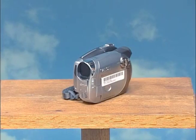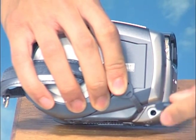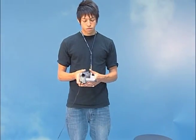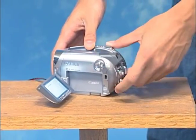Now that we've recorded all of our segments, we're going to want to finalize the disc. In order to finalize, the DVD camcorder needs to be plugged into the AC adapter — probably just a safety function to ensure a constant power source. Plug the AC adapter into a secure outlet, then on the side there's a small black input hole. Insert the small end into the DVD camcorder. Now we have our constant power source. While in playback mode, turn the camera over and press the function button — the silver button on top — that's going to bring up a disc operations display.